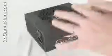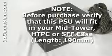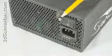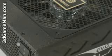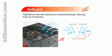Let's have a closer look at this power supply. Since this is a high wattage power supply, it's fairly long. It should still fit in most mid-sized tower cases but will probably not fit in some home theater PC and small form factor cases. It has a rough paint finish and the housing is steel. Here's the power cable connection and the power switch. There's also a power guard status LED, which is green when turned on and everything is normal, orange when in standby mode, and red when the power supply protection is active. This power supply uses AirGuard, a patented air intake with optimal aerodynamical design reducing noisy air turbulence. To achieve this, all they've done is bevel the edges around the fan, so when the fan intakes cool air, it doesn't cause noisy turbulence.